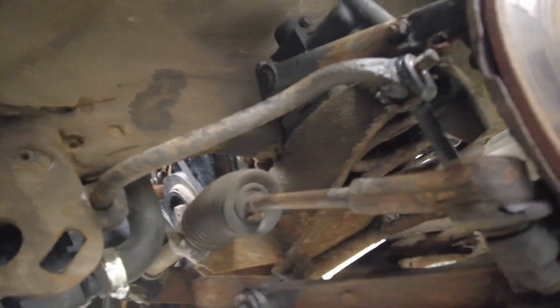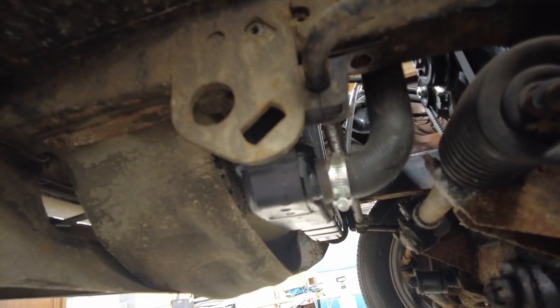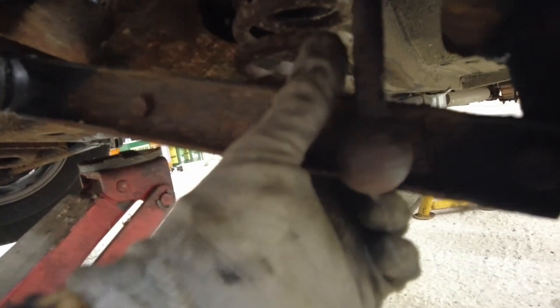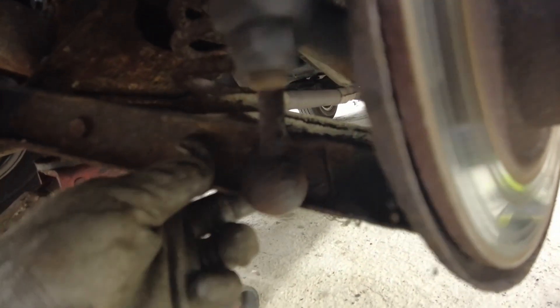Things are starting to get a little bit drastic now. I've gotten no further with that and I decided to take the saddles off here, but it never occurred to me the bloody radiator hose goes underneath the anti-roll bar and I'm damned if I'm taking the bottom radiator hose off just to get the front crossmember out. So the other option is to take off the big - I think it's a three-quarter nut - on the back of the drop link and take the drop link out. At least I can get the exposed threads and give it a belt of a wire wheel first, because you can kind of see underneath there it's a bit of a ball of rust.